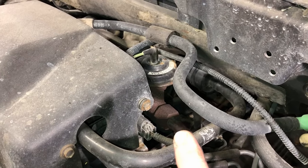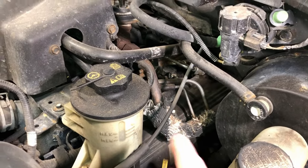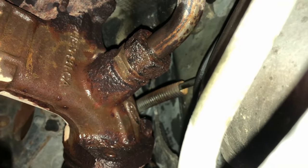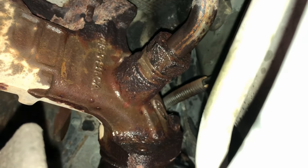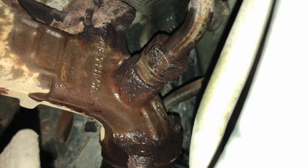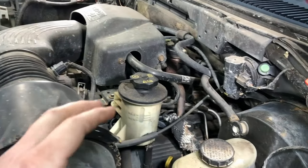You need to pull the whole EGR tube off because it wraps down around the valve cover. Down in the wheel well you'll see the jam nut where it meets the manifold — these will often be rusted pretty bad. You may need a propane, MAP, or oxy-acetylene torch to get it hot and loosen it from the nipple. Just do whatever you need to do — look at it and think: what do I need to do to gain access to the valve cover on both sides and the front cover?